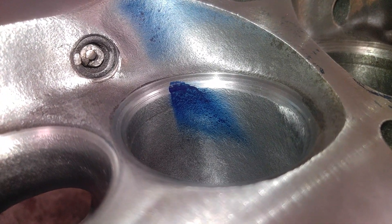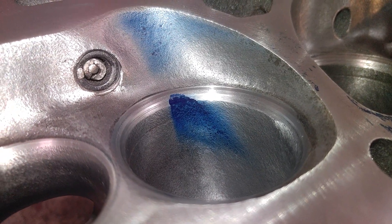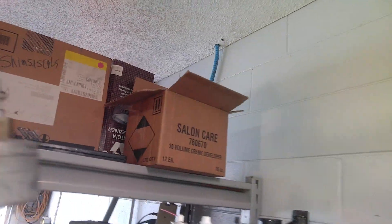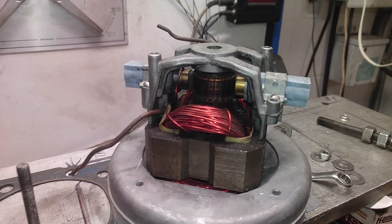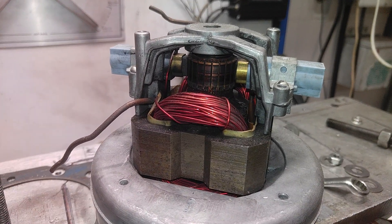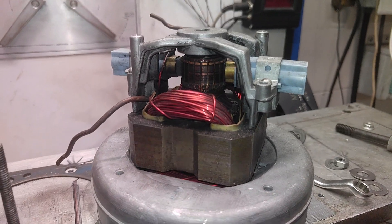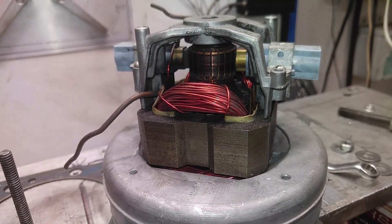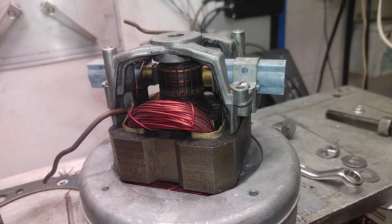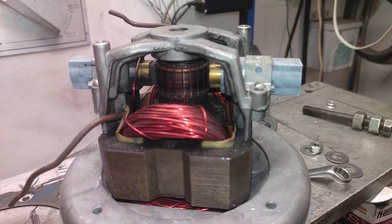The other thing I wanted to make a point of is — I'm pretty sure that spray blue is flammable. This is what's inside the flow bench guys. It's got a commutator with brushes, so it's arcing like freaking mad. If you spray a flammable substance through that, what could possibly happen? Yeah, use the spray dye extremely sparingly. That could make for a really bad day.